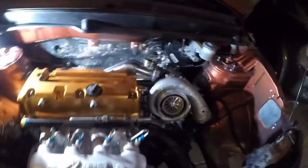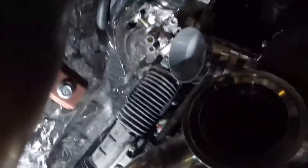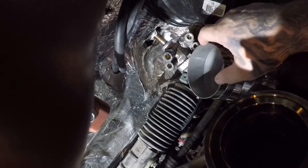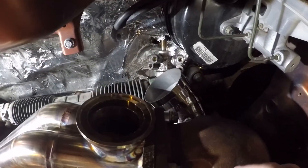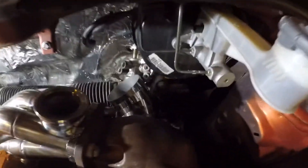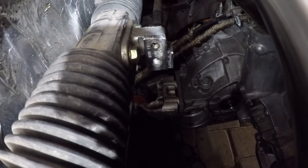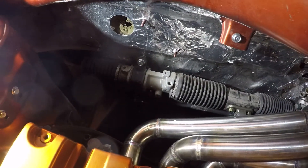The reason is pretty simple: with the new turbocharger I have a 4-inch exhaust, and the motor on the EPS unit sits right where the exhaust is. You can see the exhaust sitting there — that's the main reason why I couldn't run the EPS in the car anymore. I also made my own little drop-down bracket for the inner tie rod, dropping it about an inch to an inch and a half for more clearance for the downpipe.